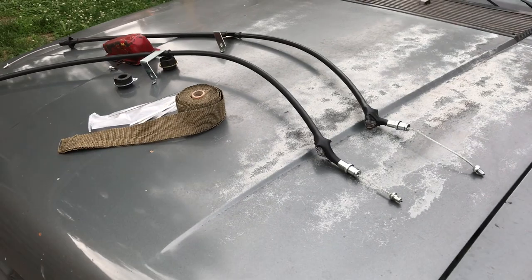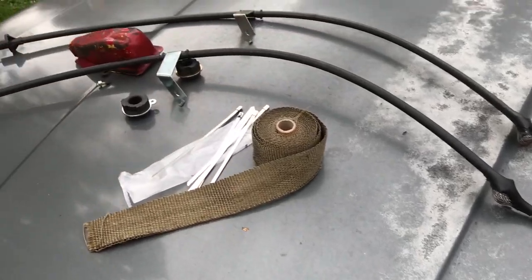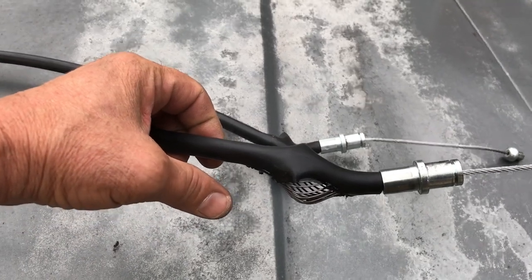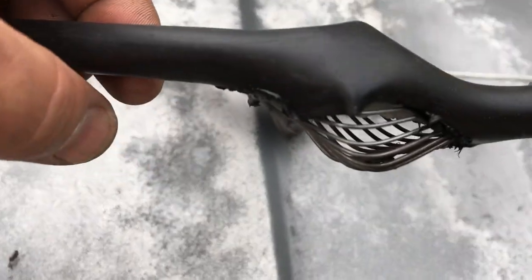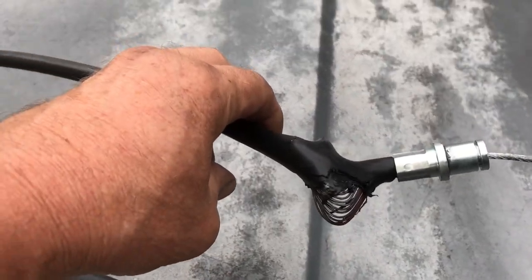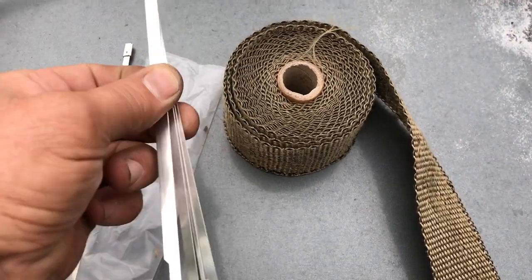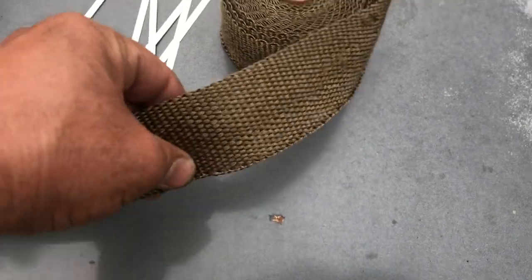Calling this the clutch cable Fox Body Mustang video. I have long tube headers on that 88 in there. This is what happened when I tried to put the stock cable back on — it's touching the header. I tried to get home from the track and barely made it. I got some header wrap with stainless steel ties, and I'm also going to use some hose clamps to tie this up on the header.